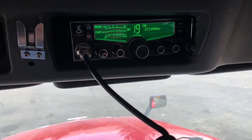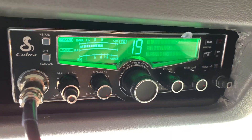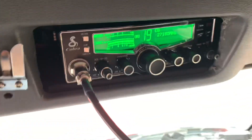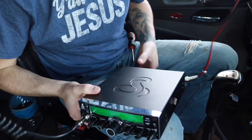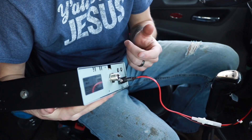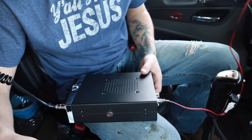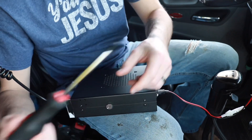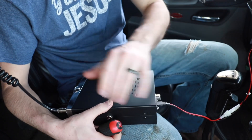So let's get into it. What I'm going to do is take the CB down and show you a quick way to fix it. So you have your CB — you want to undo the antenna and your speaker, but leave it plugged in. Then turn it over, grab a screwdriver, and unscrew the screws — leave some on and unscrew the side screws.